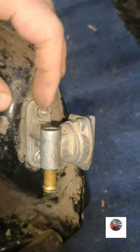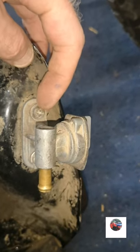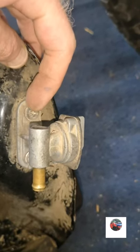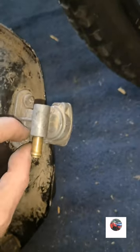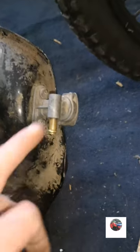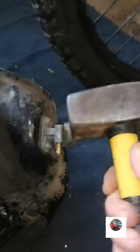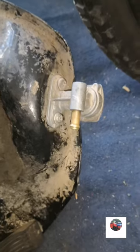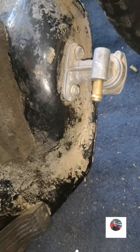So you've probably seen in my other videos, you just chisel a dint in there with a little small chisel on an angle, keep tapping, make your dint, and just tap anti-clockwise and it'll bring any screw out. Any screw on DTRs, with a little small chisel like that, a little sharp thing, with a heavy hammer though. You need a heavy hammer. Don't use a little one because you'll get nowhere. Anyway, we'll get the tank on, go over there for some juice, get in the yard, first start, and then hopefully it's done. I can upload the video.